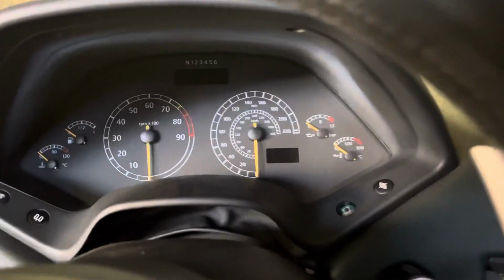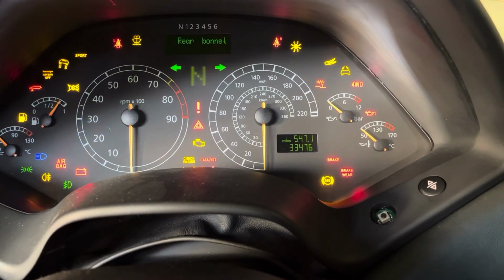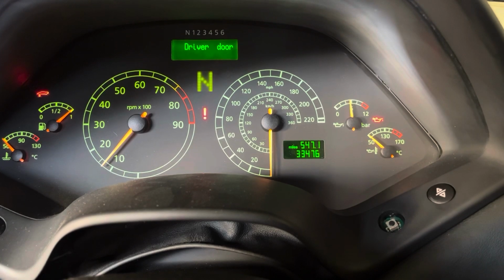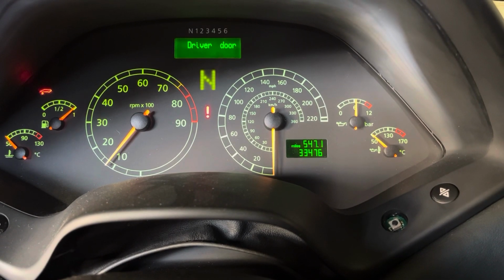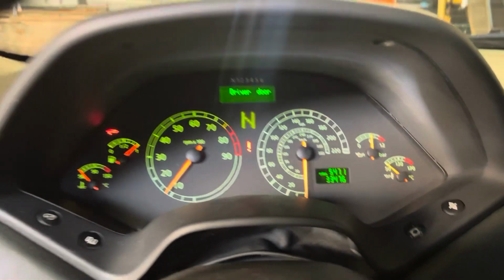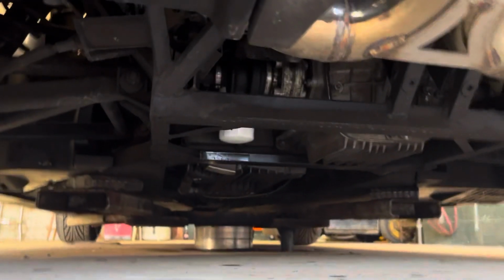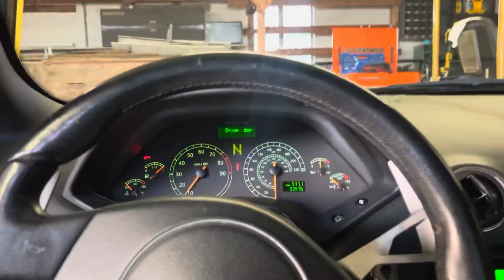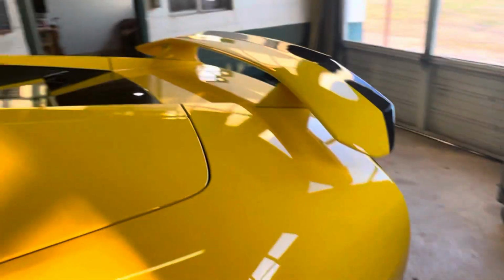We're gonna turn it over, watch for the oil pressure. Watch for the oil pressure to go up. Check for leaks. It's got oil pressure. Let it run for just a second. We're going to check for leaks. And shut it off now. I'm going to go ahead and add the other 3 quarts and check the fluid.